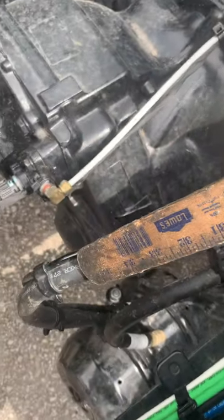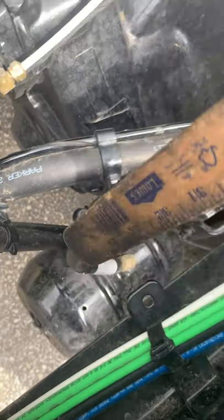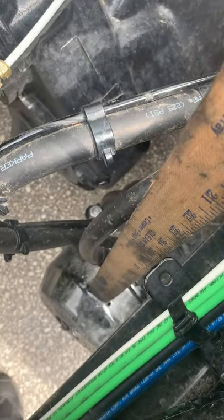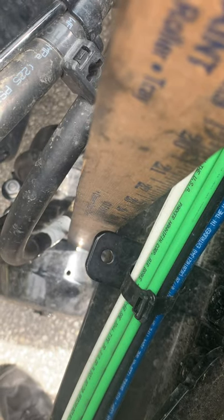Then from there you go into your brake airlines. Your brake airlines are properly mounted and secured to the brake chamber, with no abrasion, bulges, or cuts, and not leaking. Then you talk about your brake chamber. The brake chamber is properly mounted and secured, not cracked, bent, or broken. The band or clamp is in place and the brake chamber is not leaking.